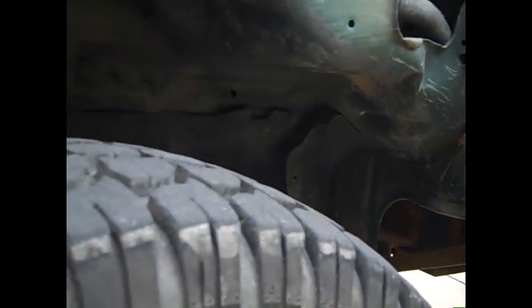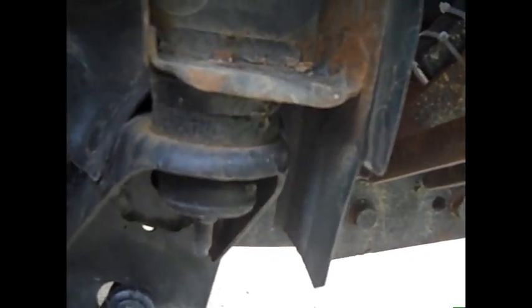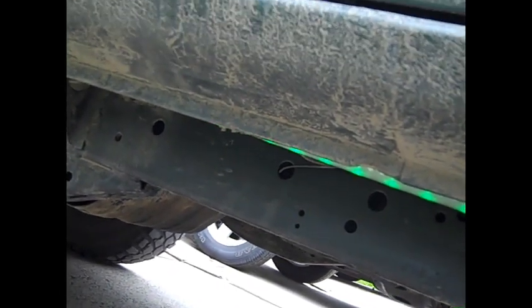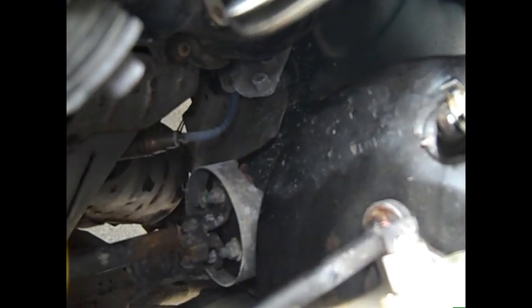Also, my torsion bars are just shot — they're cranked all the way as high as they'll go. I've got a big bumper on the front that brings it down a little more. I think the hockey puck lift is doable — there's a mount there, a mount there for the cab, and a few on the bed. The only thing I'm not sure about is the steering. Right down there is the steering component, and if you buy a professional kit it comes with an extension. It looks like I could unbolt it back here and add a couple washers to extend it a little bit — it wouldn't need much since the angle isn't that steep.